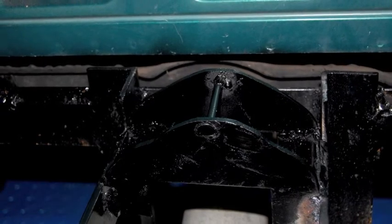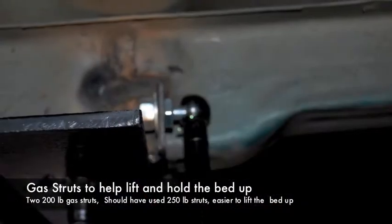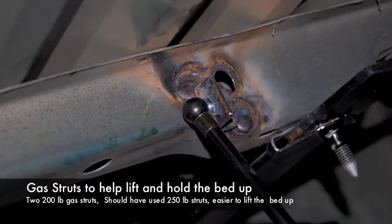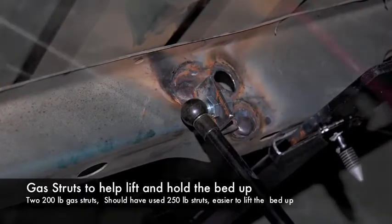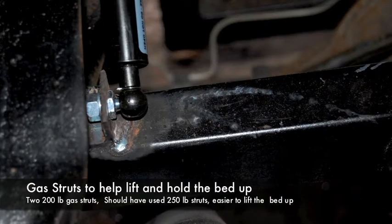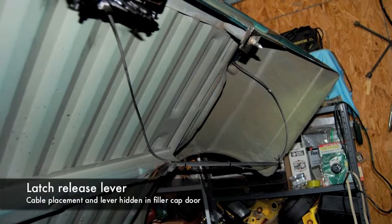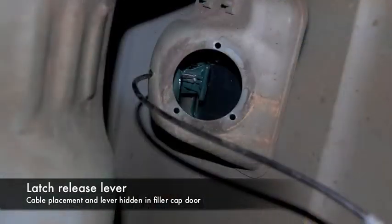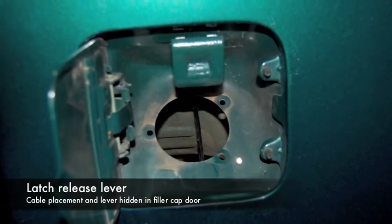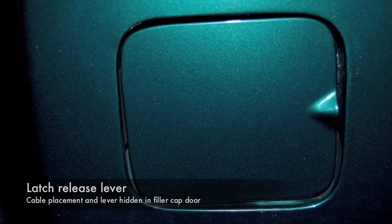It's just figuring out a method of getting everything lined up. There are some pneumatic struts that I put in there to help assist lifting the bed — they're 200-pound struts. I should have gone with the 250-pound struts. It can lift the bed fairly easily with one hand, but it takes a little strength, so next time I'll use a heavier strut. The release mechanism is hidden in the filler door, and I'll also have a plug coming out of that later. I appreciate you watching my videos and I'll try to get some more on as soon as I can. This is James from North Mississippi. Bye.